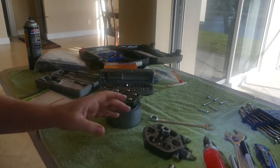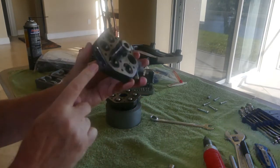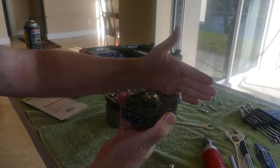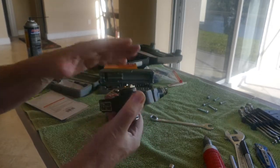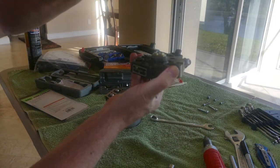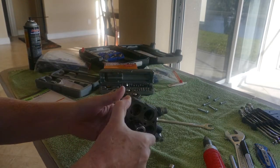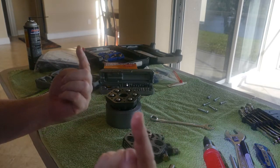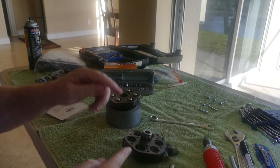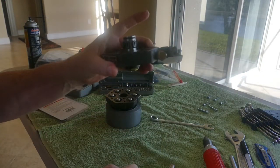This part faces towards the front of the motor, and this side is towards the firewall of the 911. You cannot work on this with the engine up against the top of the engine compartment, so you have to lower the engine. All you have to do is take off the two back motor mount bolts — with the motor braced of course — and slowly lower it down 8 to 12 inches, which gives you enough space to get this thing off.